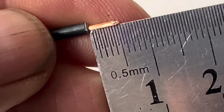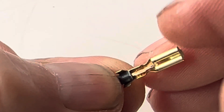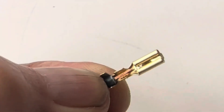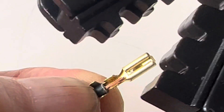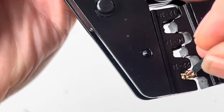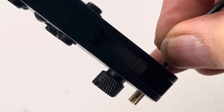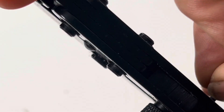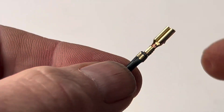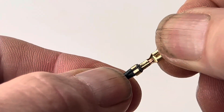I'm going to be stripping off about five millimetres of insulation for this job. That gives the perfect amount of wire in the crimp — this is a double crimp where the end crimp crimps the insulation and the first crimp crimps the wire, which is why you need a special tool with the right grooves. With the crimp held loosely in the crimpers, you feed the wire through until you can see it at the front, then crimp one-handedly. There we go — one pretty much perfect crimp, and the pull test confirms it's looking good.